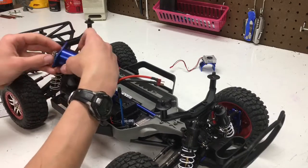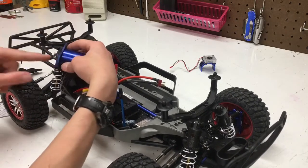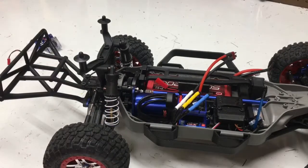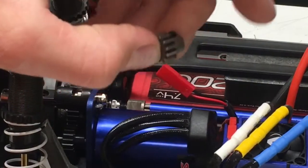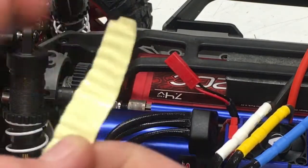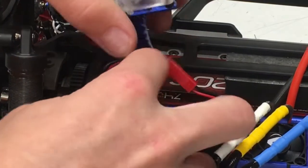The next thing I'm doing is taking off the stock pinion gear, which I believe is a 13-tooth, and putting on the 19-tooth pinion — accessed by a simple screw. I've finished putting on the pinion gear. As you can see, it's a darker shade. Here's the old original pinion, which is still in good shape, and here is the high-speed pinion gear, which is meant for high-speed 3S LiPo only on tarmac. I already did the meshing — that takes a minute — and I used this little slip of paper. A lot of people use it; it's very convenient. They use the high-speed gearing notice slip because honestly not a lot of people will read that warning — they just want the performance out of their RCs.